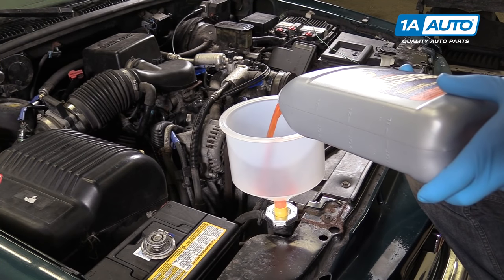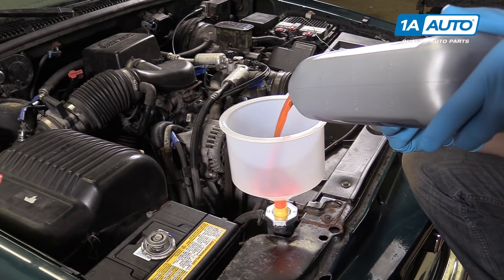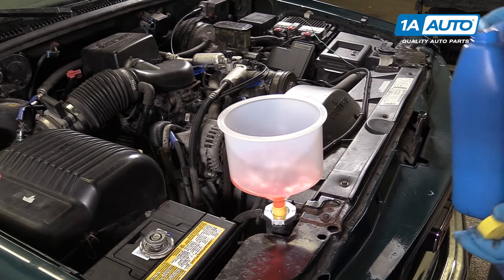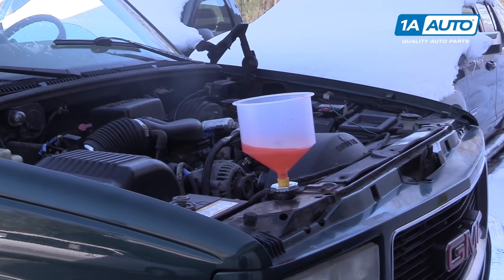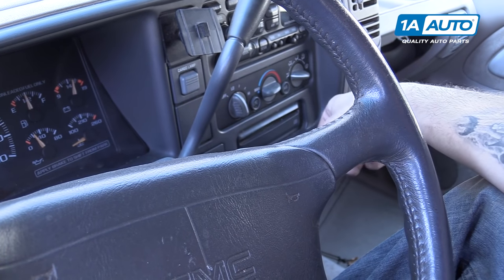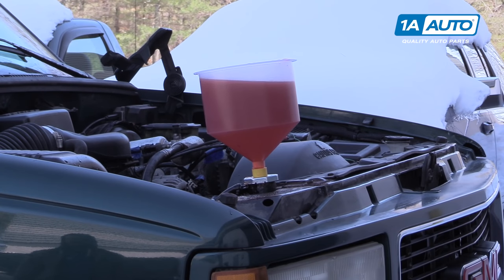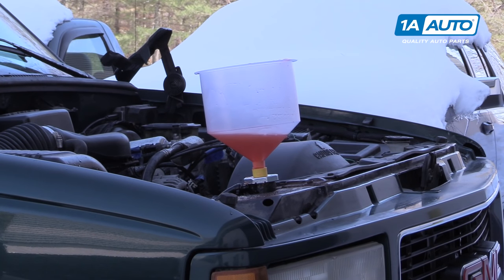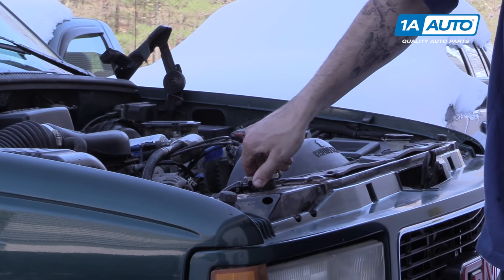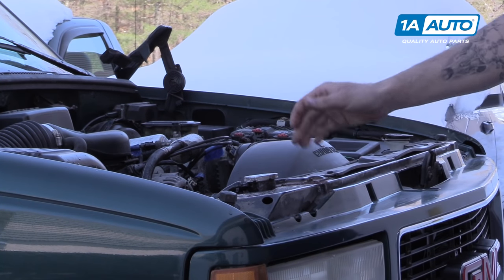Fill your vehicle with a 50-50 mix of DexCool coolant. We're using a special funnel to show you how much air actually comes out of the system, but any funnel will do at home. To finish bleeding your cooling system, simply leave the radiator cap off, start your vehicle, and set your defrosters or vents to the lowest fan speed and highest temperature setting. This will allow the heater core to bleed as well. Run the vehicle, keep an eye on the temperature gauge, let it get up to temp, and monitor the coolant level inside your radiator, topping off as necessary. You'll notice several surges where it sort of burps, an air bubble comes out, it loses some fluid, you top it off, and this process will probably repeat a few times. Remove your funnel, reinstall your radiator cap, fill the overflow, and your vehicle is good to go.